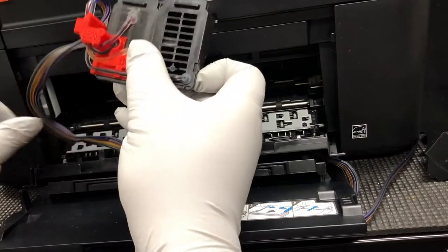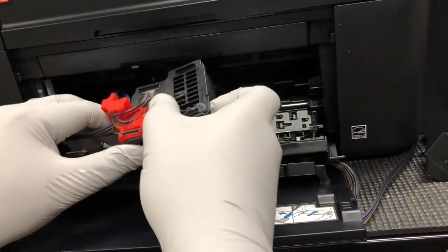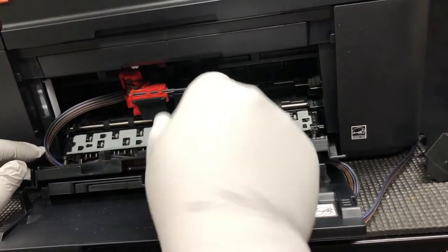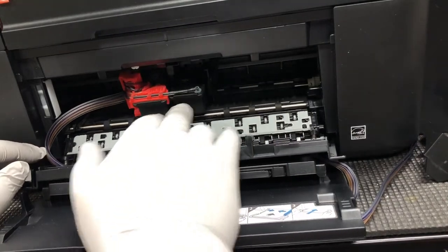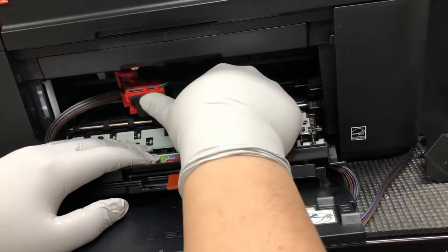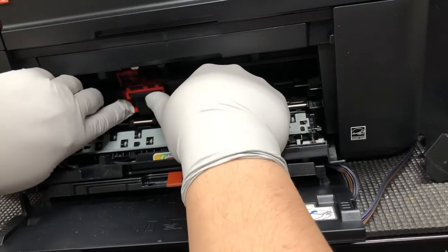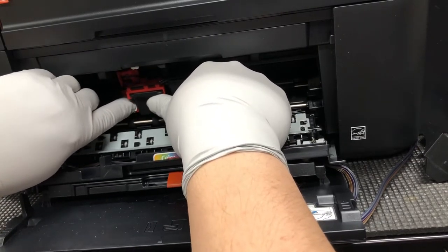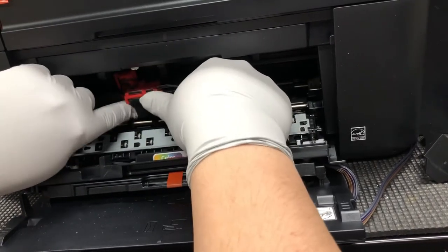To insert a cartridge, you hold them as a pair and make sure the cable is not twisted. You don't do it horizontally — you sort of sit it from here at an angle, pulling that, and just push it. If you find the orange clip is a little bit hard to push, you separate it: use your fingers and separate the clip a little bit, then push.